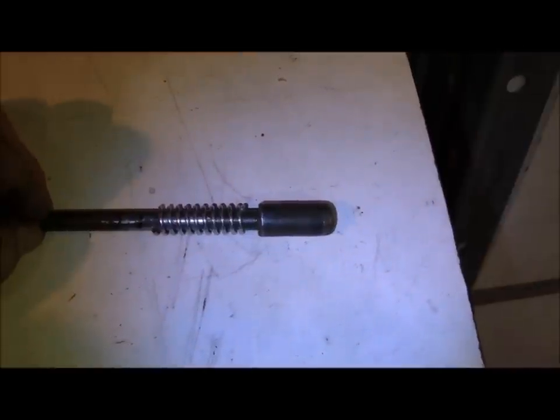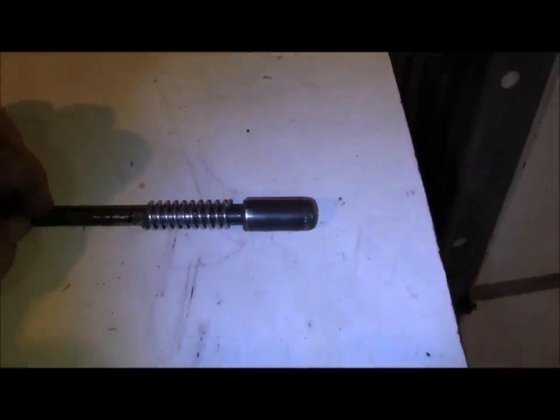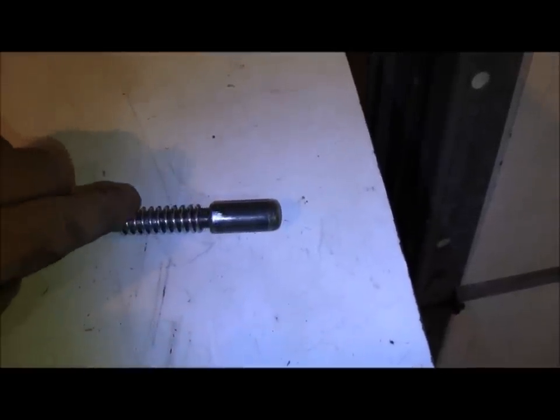Here is our trailer leg release pin. This is a reproduction part — also a USA-made part — but like a lot of reproduction parts we did a little modifying to it. We ground a bit of a taper on the end so it goes in easier, and I also ground a little chamfer on the back edge so it pulls back easier. Test fitting revealed I wanted a little less spring tension, so I cut two rings off the spring and test fit it until I got it the way I wanted.